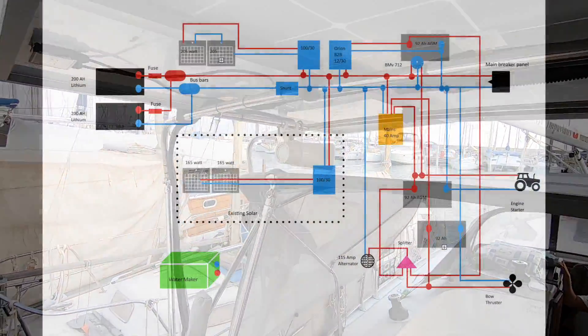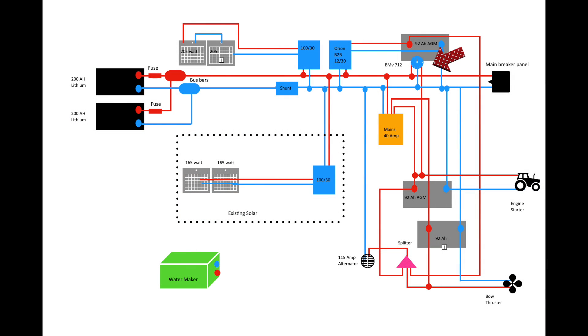Now there's just the battery monitor. The BMV 712 is pretty easy to fit. It comes in two parts - there's the monitor or screen which you program, and then at the other end there is a shunt that goes on the negative side of your battery. That tells the monitor how much current is being used or put back in. The negative line of the house batteries has the shunt in it - just two bolted connections to the terminals. It also connects on the positive line of the house batteries. The BMV can actually monitor two sets - it can monitor your engine battery as well. The monitor and shunt are connected by a Cat5 cable - simply a plug-in at each end.